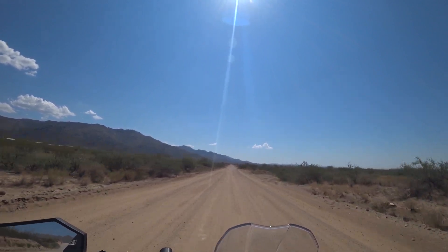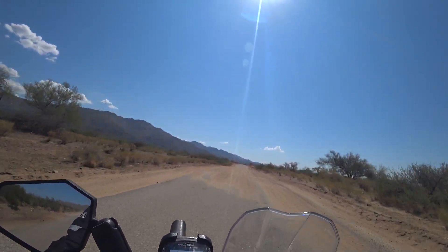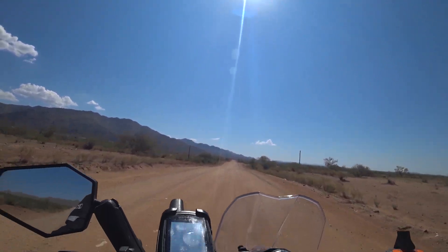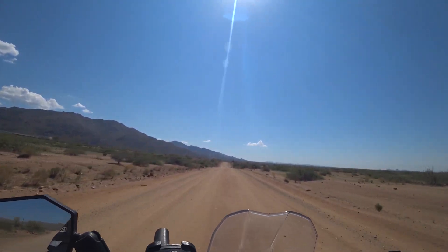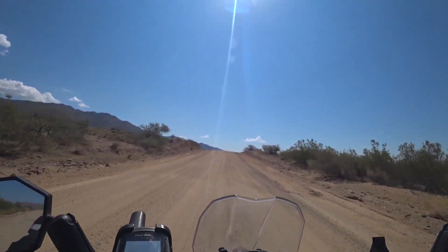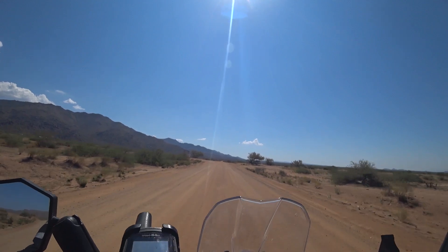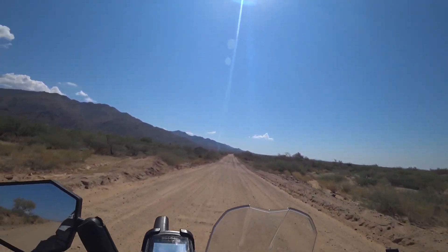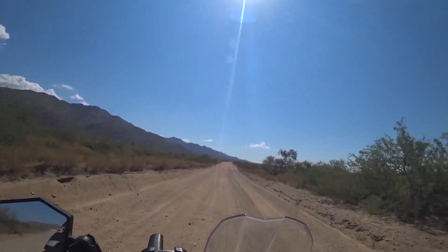What I use to ride off-road works for the Tiger 800 and pretty much any type of off-road condition — it's kind of an all-around setting. I use 25 PSI in the front and rear tires. That gives you good traction off-road, and if you're crossing over pavement or too tired when you get home to reinflate, 25 PSI will get you home safely in most cases — just not at 100 miles an hour.